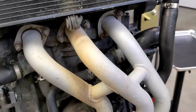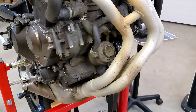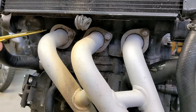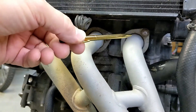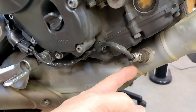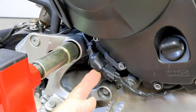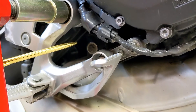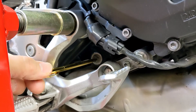I decided to take off the exhaust system so you can see the radiator better. It's fairly simple — six bolts, one exhaust pipe for each cylinder. Unscrew the O2 sensor right here, there's an electrical connector there. There are two bolts in here that hold the muffler on, and then one on the other side.